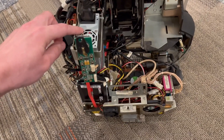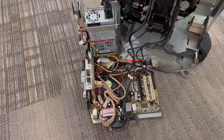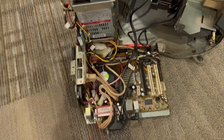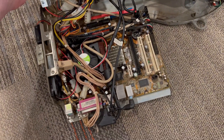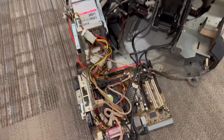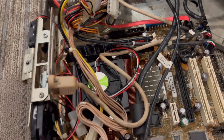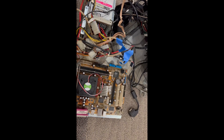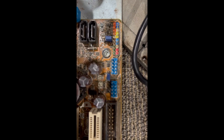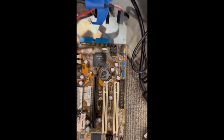Just be careful — this power supply is actually on a hinge, so you don't want it to fall down on you. I'm going to pull this out and to the left with the camera off, and then I'll come back. So now I'm going to unplug the power supply. I took a bunch of pictures before this just in case I needed to put it back together. I have some painter's tape on there with labels — I basically looked at the letters on the board, like USB 5, 6, and wrote that on the cable that came out, and USB 7, 8, and so on, just in case I needed to reassemble.